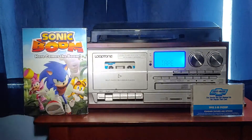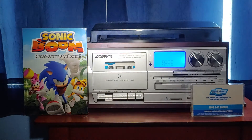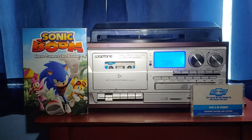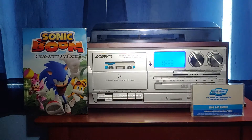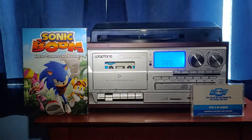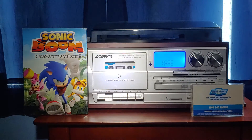Your electronically tuned AM or AM-FM stereo radio has convenient functions like speaker balance and bass and treble adjustments. If you have a cassette player or a cassette player with graphic equalizer, their operation is discussed on side two of this tape. On the AM-FM stereo, the seek button allows you to seek out the next available station, and the scan button allows you to briefly sample all available radio stations. To preset 4 AM and 4 FM stations, find your favorite station using the tuning knob or seek and scan controls, then press the set button and within five seconds press one of the numbered buttons. You can also combine adjacent numbered buttons simultaneously — like buttons 1 and 2, 2 and 3, or 3 and 4 — to expand your preset station selections beyond 4.